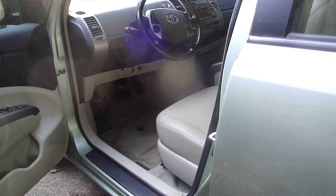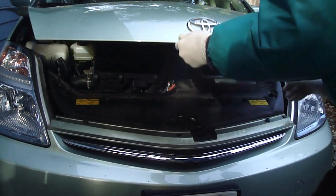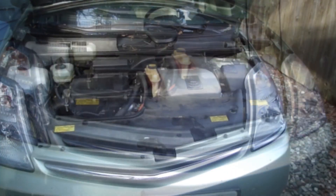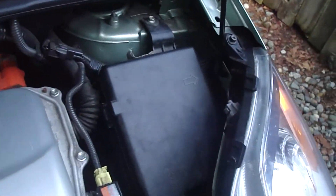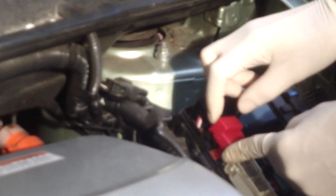Open the door and release the hood latch. Locate the fuse box, which is right here. You want to uncover the positive terminal — there's a small black tab right here that you pull out. Don't break it; you just want to release this little nib on the red cover. This is your positive terminal. Attach the positive battery cable from the jumper here, and you can use this strut mount here for a negative to attach to the frame.